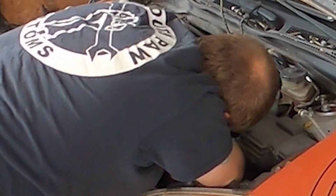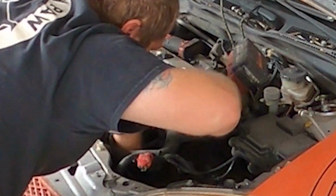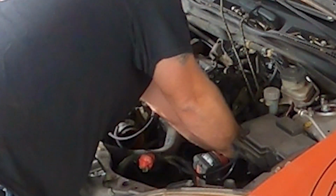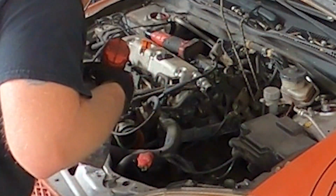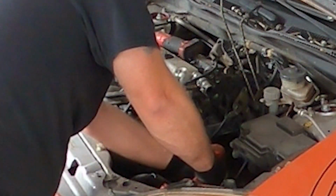Alright, so remember, I said in the beginning of this video, this wasn't an instructional video. Well, it turned into one. I skipped over an entire step here during the recording that I'm now looking at. You're staring at a transmission mount. It has two 17mm nuts and a 17mm bolt, along with a large 17mm nut that goes through the transmission mount on this side of the car. You do have to take all that loose to get the transmission out.